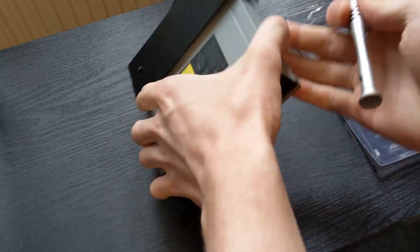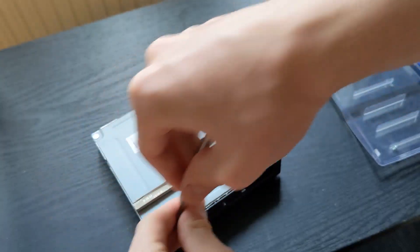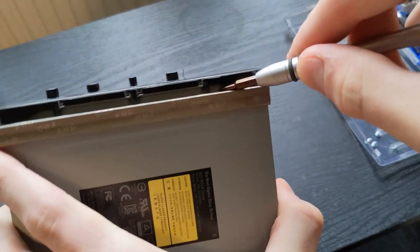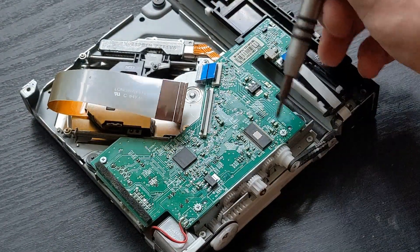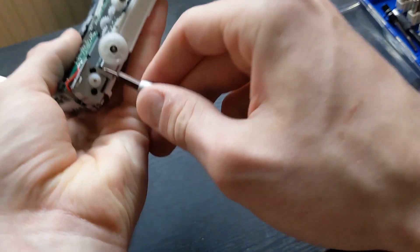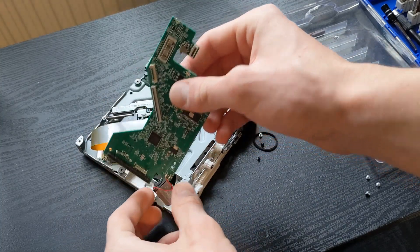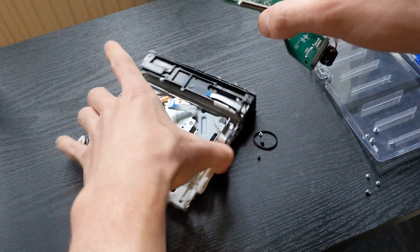Here's the new disk drive — this gives us a good chance to recap. Quick rundown: T10 screw, take out the plugs, remove the plastic cover, remove the padding, unscrew the corners, slide that off, unhook the ribbon cables. Before that, unhook the plastic clips, slide off the metal base, then unscrew the three logic board screws, take off the fan belt and the two black screws, and bring up the logic board. Remember there's a plastic piece — lift it up and slide it out, and the motor comes straight out.